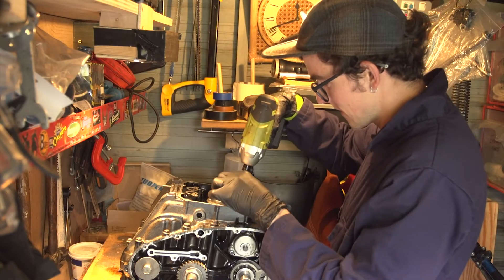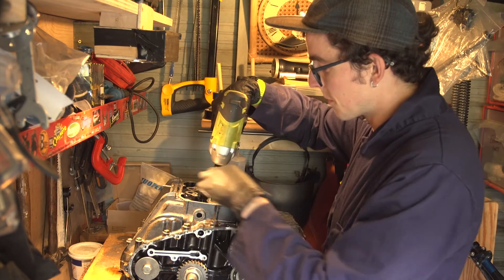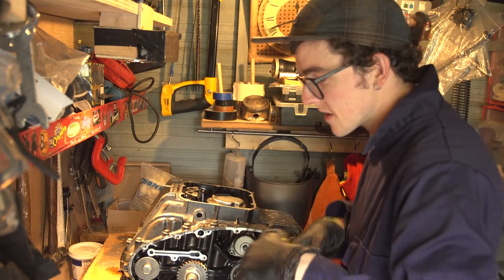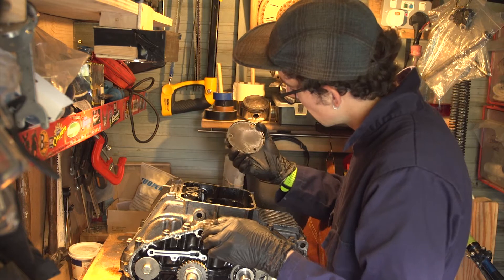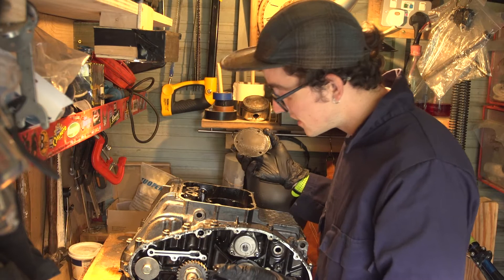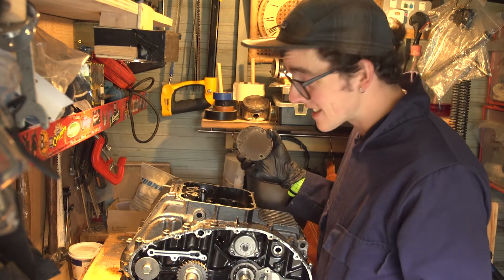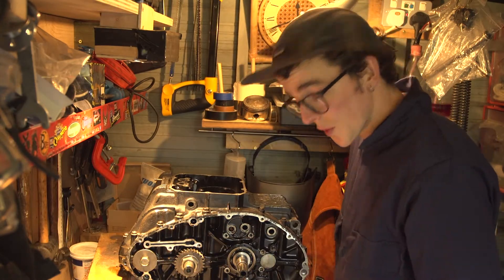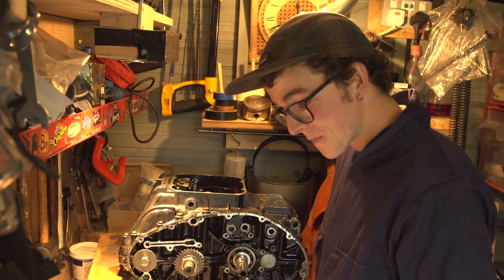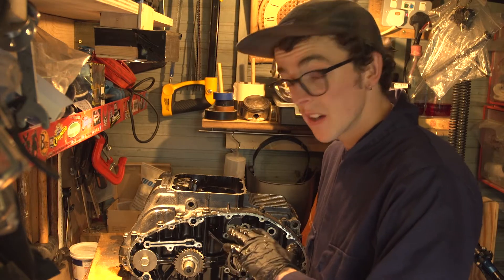This bike's from the 90s so it probably doesn't have any asbestos in the gaskets, but I like to be safer rather than sorry. Under the sump is an oil strainer — a secondary oil filter that catches any big lumps and chunks. It doesn't get changed as often as the main oil filter at the front of the bike, so there's a good chance it's going to have some gunk in it. Yeah, a good amount of wee bits of debris, nothing major and chunky, which is a good sign — means nothing too horrible has been bouncing about in the engine. Now I'm going to take all the crankcase bolts out. It's quite important that they're slackened evenly so you don't distort anything — the mating surfaces don't have any gasket, so it is really important that they are totally flush and flat when they go back together.